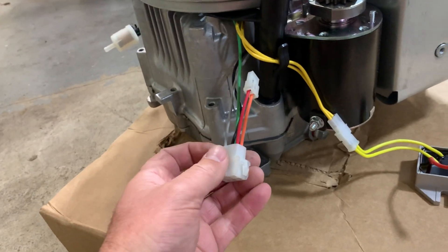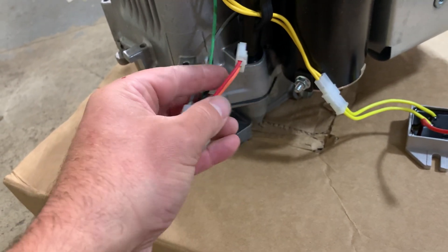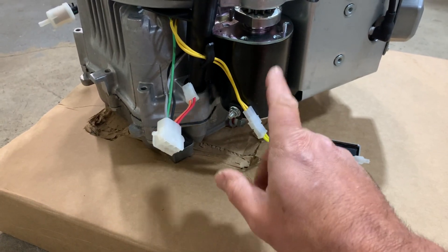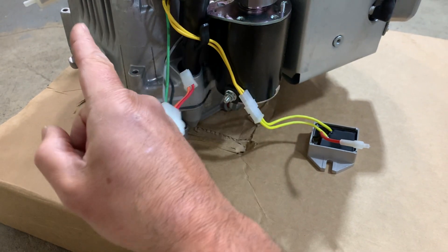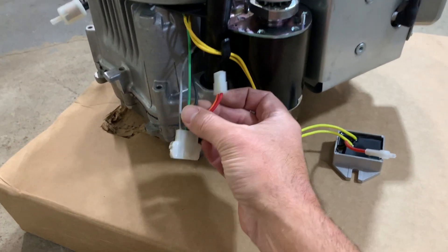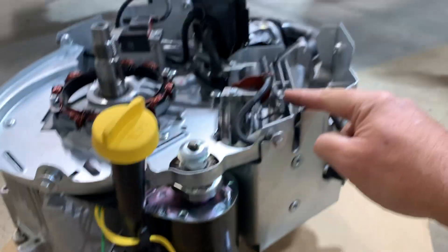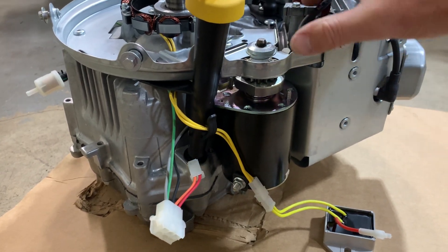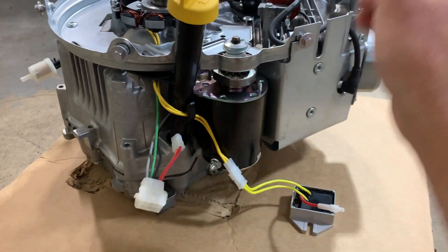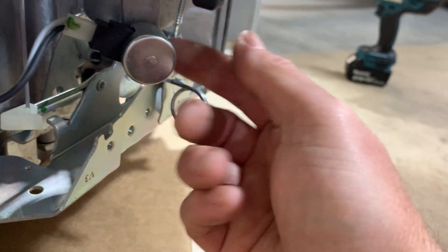On this new Briggs engine, the plug fits the existing Hustler mower — I'm converting it from a Kohler. There are three wires going to this connection: the green wire goes to the low oil pressure cutoff, the black wire comes from the coils and handles ignition, sending power out to the coil as the flywheel fires the spark plug. The gray wire goes to the fuel shutoff.